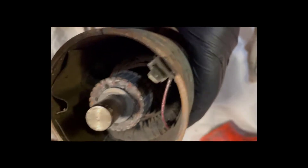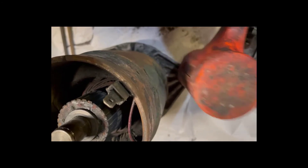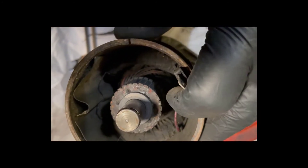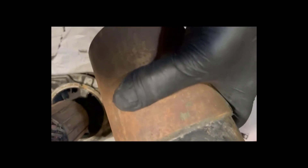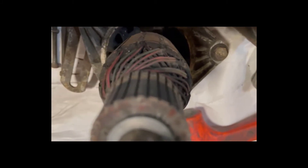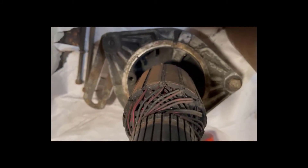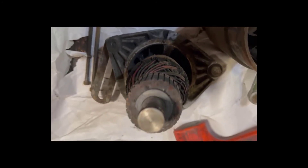What we can do is take off the outer casing pretty easily — a couple of gentle taps on the bottom part here and this should become free. Just don't break this wire here, it should be attached to the casing. There we go. There's the armature free. There's the casing free. That way we can work on the casing and clean it up without getting any debris in here, and we can clean up the area of contact. Hopefully when we put it all together things are going to work. If not, we'll take the pulley off this one and get a rebuilt one, but I'd like to think we can save this one.